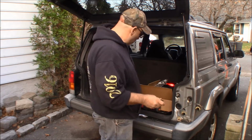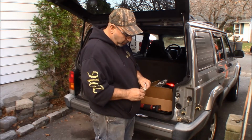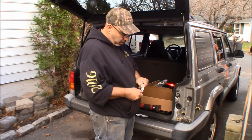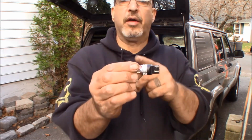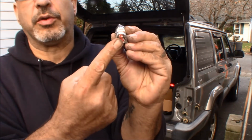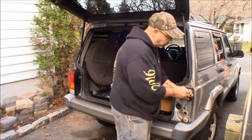We're going to take a little bit of dielectric grease, and I'm going to put some on either side of the bulb socket, just to prevent corrosion from heat in the future. These LED bulbs have a decent heat sink on them. They are a projector in the front, and then they have the LEDs going around the side. Like I said, the specs and everything will be in the description below.